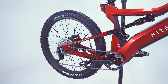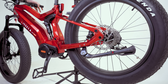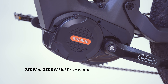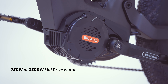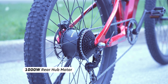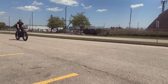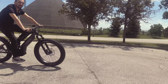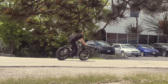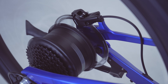Let's get started with the motor. The main difference between these two bikes lies in the motor placement. The Mega features a Bafang mid-drive motor, either 750 watts or upgraded to 1,500 watts, which is integrated into the frame near the bottom bracket. In contrast, the Revenant's Bafang 1,000 watt motor is a rear hub design that seamlessly incorporates the rear wheel. One of the nice things about the mid-drive motor is that the bike feels more balanced, while the rear hub motor feels more back-heavy due to the motor being in the rear wheel.